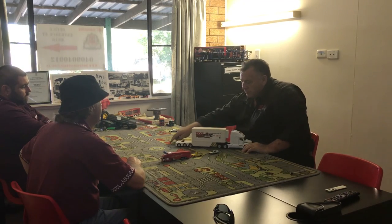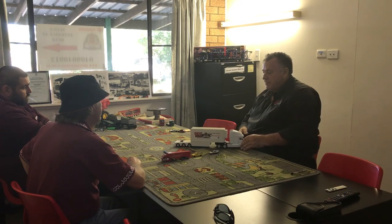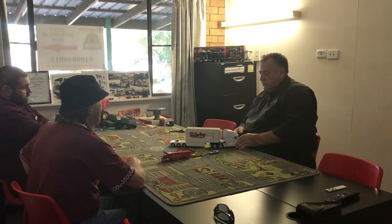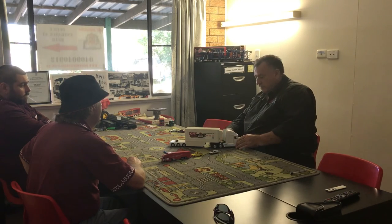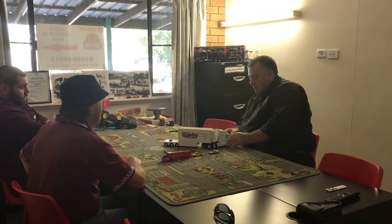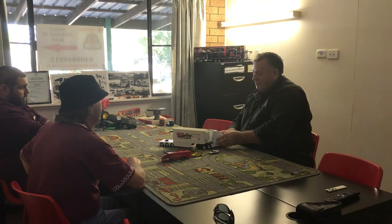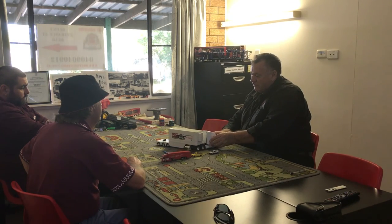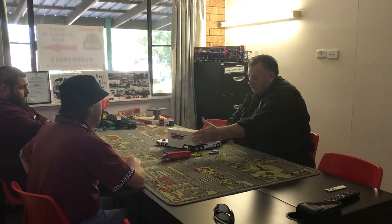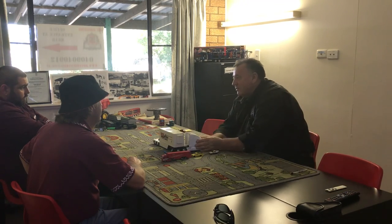I'm obviously going to be facing here, but I'm going to get out and have a look, because you're only just learning, okay? Now you're going to reverse back up, and as you reverse back up and around the corner, you know that you're going to put this at a 45 degree angle. So you reverse up to about halfway around and get out and have a look. And then you reverse further until this gets to be 90 degrees. Get out and have another look.